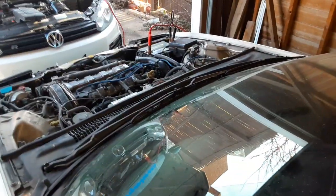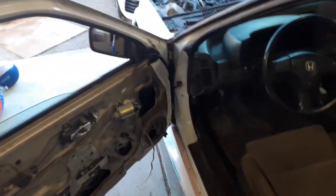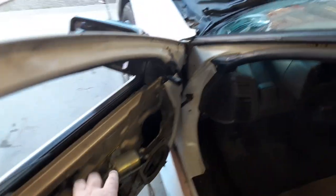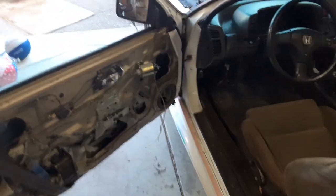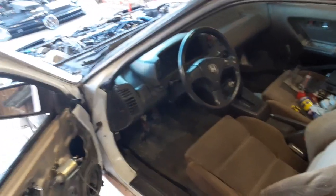I have it gutted on the interior for the most part. I was working on the fuel return line today — got that fixed, that was one of the problems. The other problem, believe it or not, was inside the distributor: it was missing a screw, and that's what's been keeping this thing from running. As you can see, it has actuators for opening and closing the door wirelessly — that's a power cable for that.